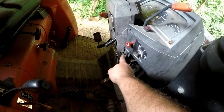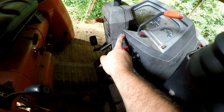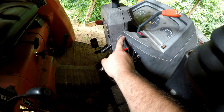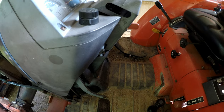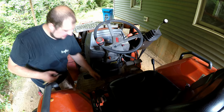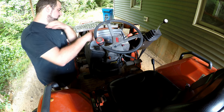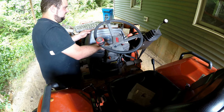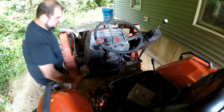On the other side there are also 12 millimeter bolts — I assume those fell out on this old tractor — and those were probably Phillips heads as well. On this side of the tractor, another 12 millimeter, another 12 millimeter, and a Phillips head. The other piece I'm taking out of the way — I forgot to mention — is the cowl around the steering wheel, which is also a 12 millimeter bolt. Now you can see the cluster is somewhat loose and this side of the dash is almost loose. Let's go to the other side and take those two bolts out.